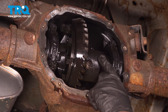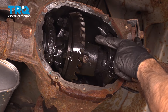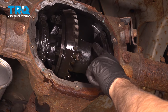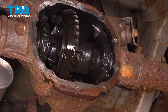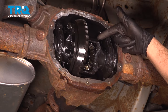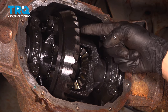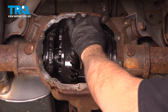Now we're inside of our rear carrier unit. We need to access our axle shaft that runs through the housing and into the middle. We need to rotate this unit to gain access to the other side, which has a bolt in it, because we need to remove the pin running through the middle. With the vehicle in neutral, grab that drive shaft and spin it. Right on the top is the bolt we need to remove — it intersects with the pin in the center, locking it into place. We're going to loosen and remove this using our 5/16 wrench.